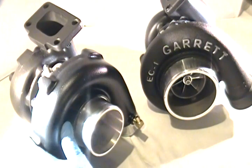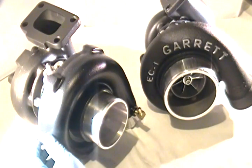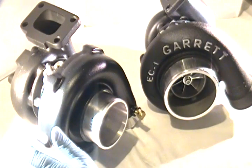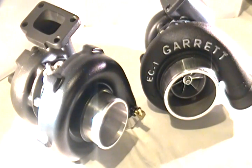The Predator, on the other hand, is slightly smaller — but not too small — making it a direct bolt-on upgrade over the T3/T4E series of turbochargers and even an upgrade to the Surfer. It targets around 450 to 600 wheel horsepower. It's slightly smaller, a bit more responsive on the street, especially with transient response between shifts, but not as impressive on the dyno unless you push a lot of boost pressure.